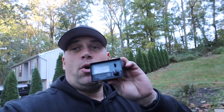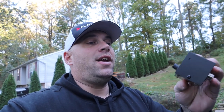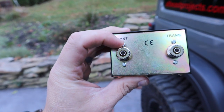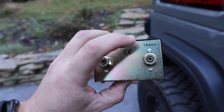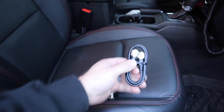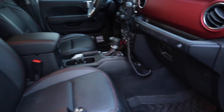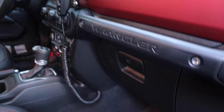Very nice, very clean, cool kit and a very clean installation. I'm back home and lo and behold my SWR meter came in. I ordered this off Amazon Prime yesterday and it was here when I got home. I'm going to tune this antenna. I am no CB expert but I've done a little bit of research. Pretty self-explanatory for setting this thing up — you have your antenna line where your antenna screws in, and this screws into the line going into your CB radio. I got this SWR meter with a little pigtail so you can connect it and get your stuff tuned up. I'll have a link in the video description.